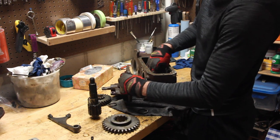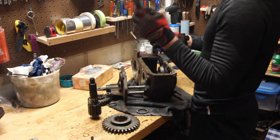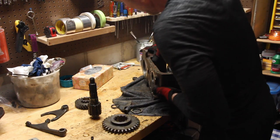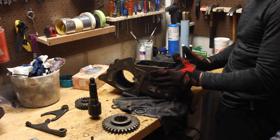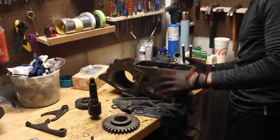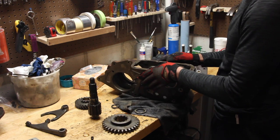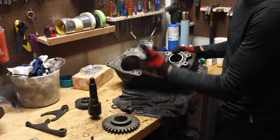Sliding the shift rail down to the end and off. Inspecting as we go: this is the rear output shift fork, this is the front shift fork. Then you can slide the whole shift rail assembly out through the front. There's one last piece - the bearing race cup for the front drive shaft bearing. Just take a bearing punch and pop it out, and at that point you're pretty much done with the main casing.